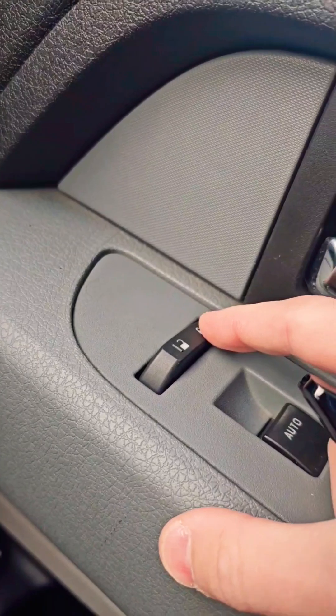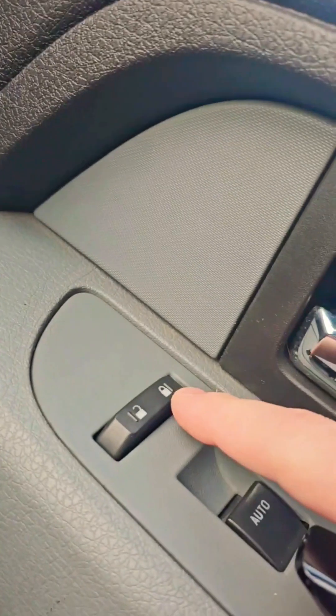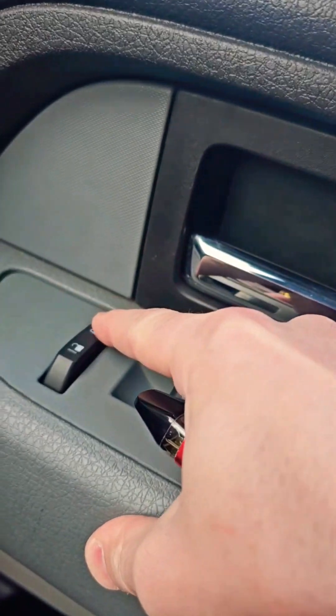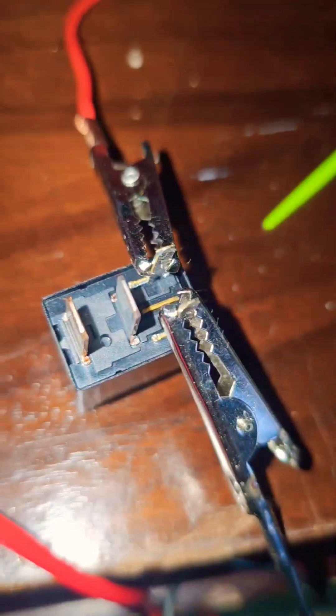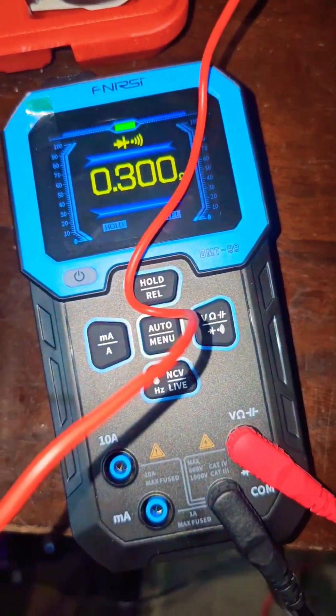Even more undesirable behavior: the same principle applies on the passenger door. Pressing the lock down and pressing the lock button causes all the doors to unlock. When you press unlock there is no signal and no noise to the relay, but when you press lock the doors attempt to unlock with noise throughout all door locks. Testing relay number 49 under the passenger kick panel near the BCM fuse.